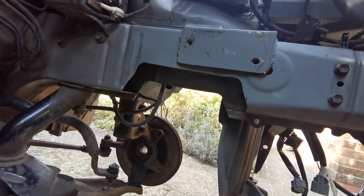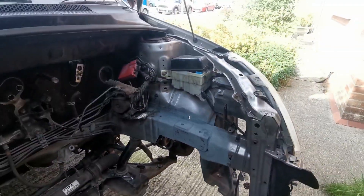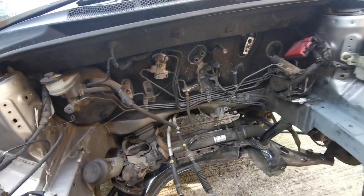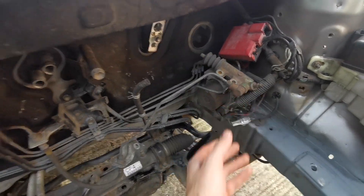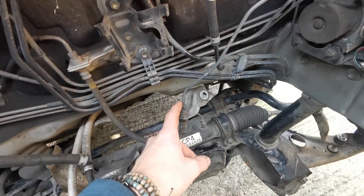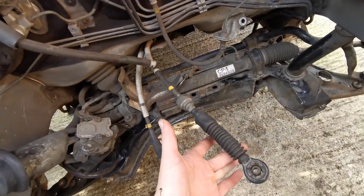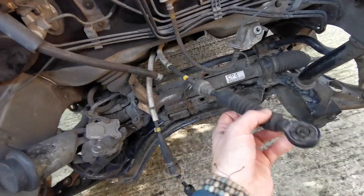Going to cut some bits of sheet for that, and we're going to get that welded in and closed up, and then we really are making some banging progress. What I want to note while we're here - clutch slave cylinder - I'm going to have to swap this out for the Celica one, because that fits over the Celica box which sits here, the Yaris one doesn't fit. I think I've covered before that I need to use the Celica shifter cables because these do not reach.